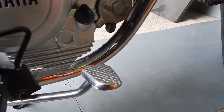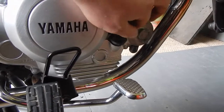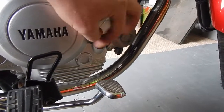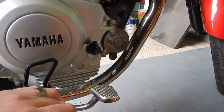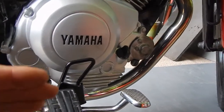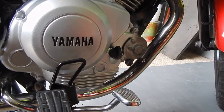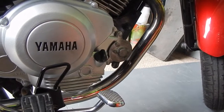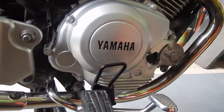Moving on to O for Oil. Some bikes have a sight glass; this one has a dipstick. The method of checking varies per bike — some manufacturers like you to check it wound in, some with it resting on top of the threads, and some BMWs require you to check it on the side stand. Oil capacity can be written on the side of the crankcase; if not, refer to manufacturer's specifications. When checking your oil, it's not just the level but the colour and consistency. A clear golden-brown colour indicates it's fresh. Black, milky, or grey colour may indicate an internal engine issue or clutch plate problem, as most bikes run a wet clutch system.